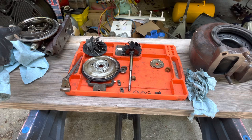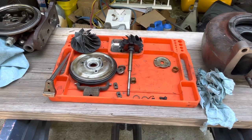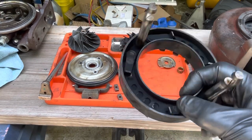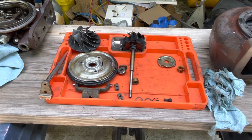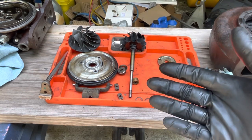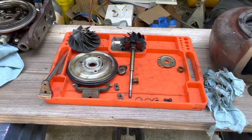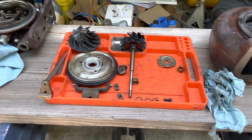We're going to get everything soaked and cleaned in the ultrasonic cleaner and get the parts kit ordered. This turbocharger has to be extremely clean going back together, especially inside here - the journal area has got to be cleaned out. You can pressure wash this stuff, nothing in there will get hurt. The major problems with these turbos are the VGT nozzle tabs breaking off, carbon and gunk buildup, the actuator going out, or an actual turbo failure - really only three major problems.